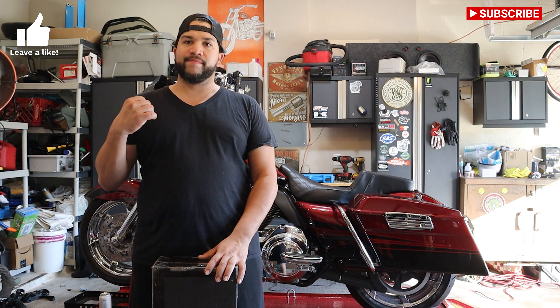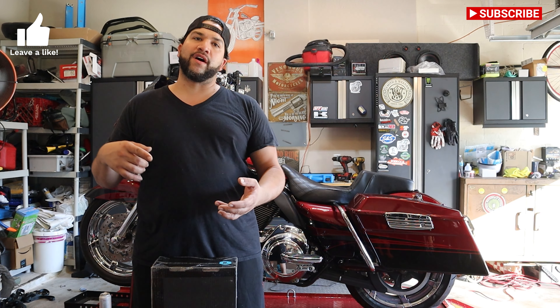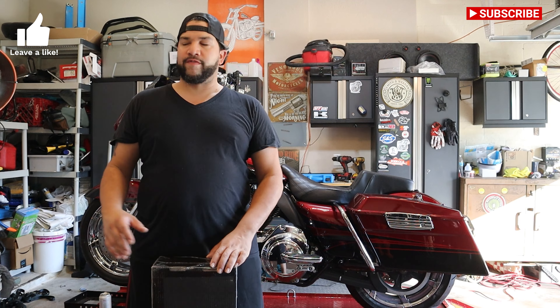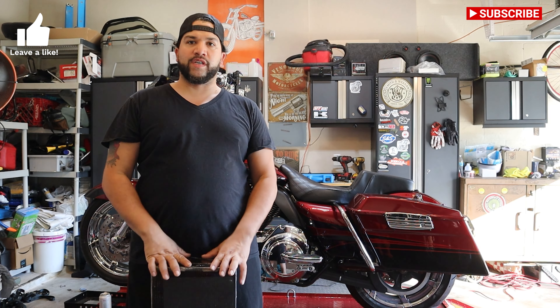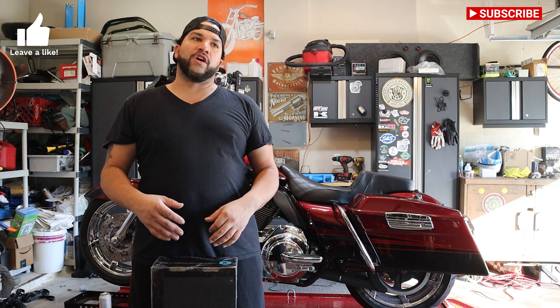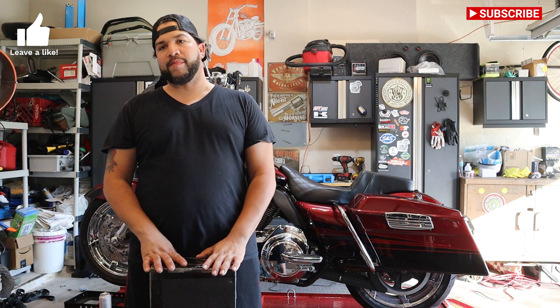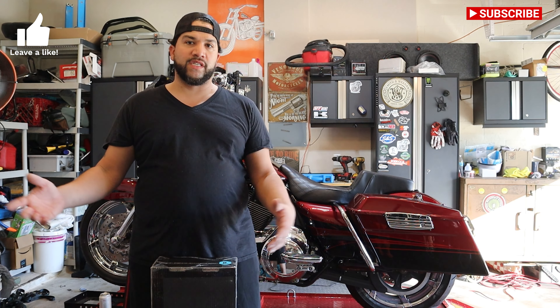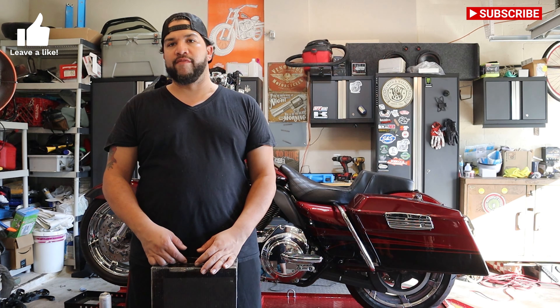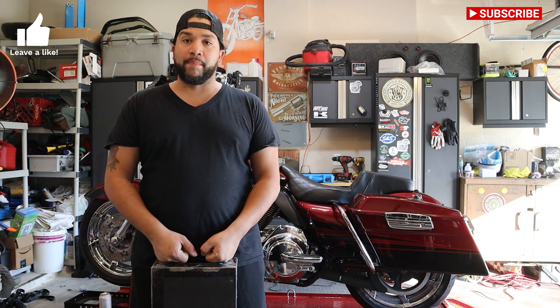Today I'm going to start doing the cartridges in the front. To do that, you take the wheel back off, take your front cluster off and your front plastics over where your ignition is, then slide the forks down. I'll set it all up and go through it. I'm not an expert by any means - I'm just following the instructions and some stuff I've seen. I just figure I'll bring you guys along on my adventure.